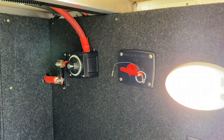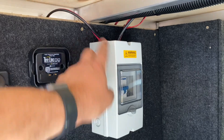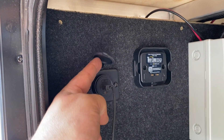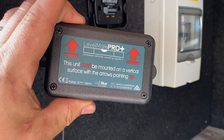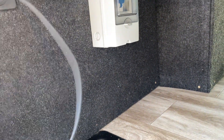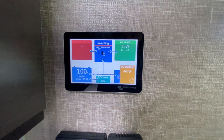We've got a 400-amp shut-off fuse, and this disconnect we kept in place for the coach side. Over on the other side we have the PV in/PV out with a disconnect. We also added a 12-volt USB plug for the customer so they can run their LevelMate Pro through this USB cord — that was important to them and we had no problem taking care of that.